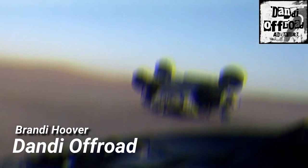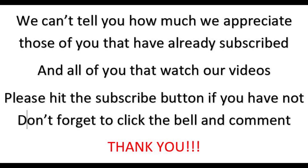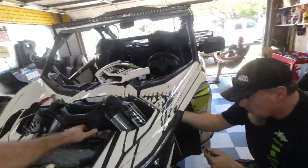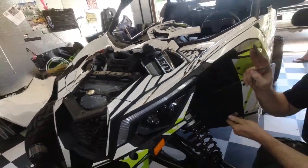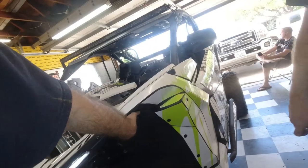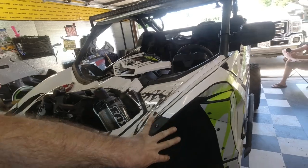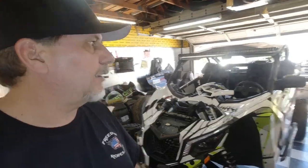Nice! How awesome it is. So the radiator fan housing, whatever it's called, it's all kind of one piece, is broke right here. See? Right there. There are a couple little clips that hold this top piece on underneath that we have to pry off. Those clips hold this piece right here? Yes. You can see that's loose now. Then we're going to pull this whole clip, and there's a couple T30s that we have to get loose too. All right, we're going to put you on a tripod. We'll be back.